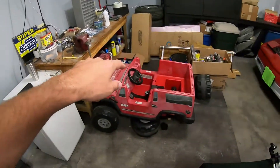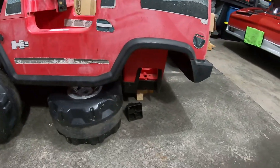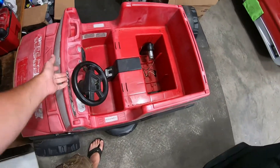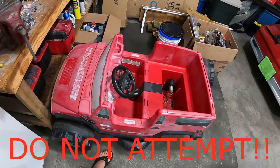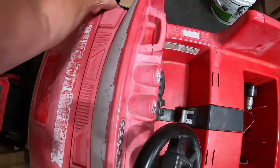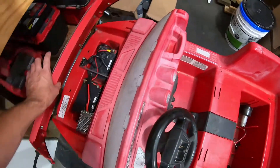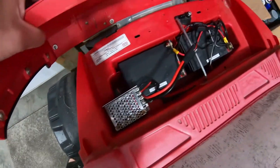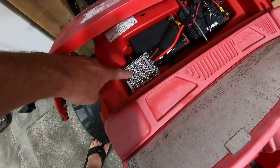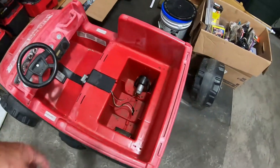I also wanted to mention I picked up a new vehicle — yes, I am working on a Hummer H2. We're doing a rear-end swap and adding some gearing. This is actually my kid's Power Wheels; I made my wife pick it up off the side of the road one day. We have a different one they ride around in, but I wanted one I didn't care about to mod. What I did was wire two 12-volt batteries in series to get 24 volts, and put a voltage regulator controller on it to make it go faster.